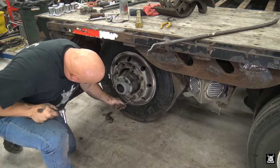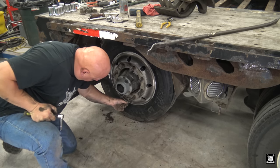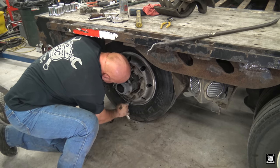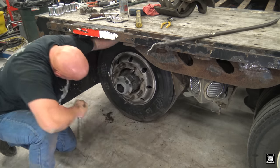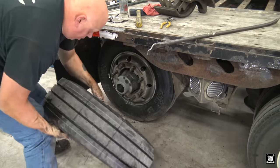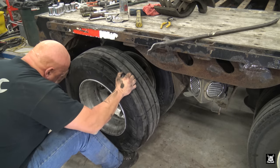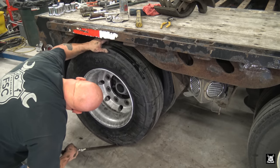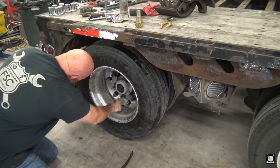The other thing that I do is I line these up, and I put the extension on the inner tire. That way it's easier to put air in or check the air, it fits through the other tire. Perfect. Just gotta make sure you don't mess that up. Position this tire so the valve stem is straight up. I'll walk it over. Oh, looky there. Look what's peeking through.